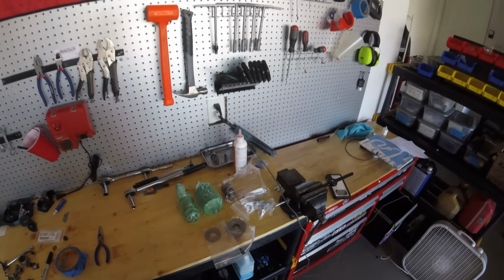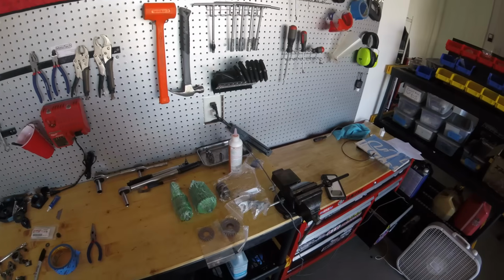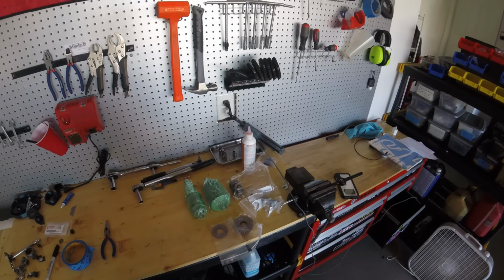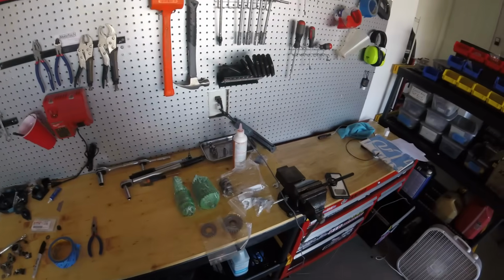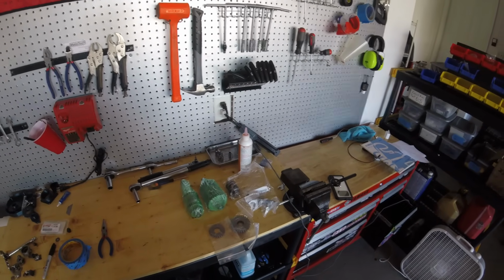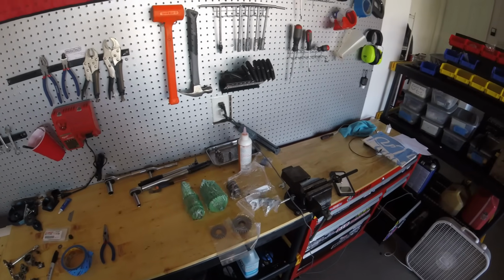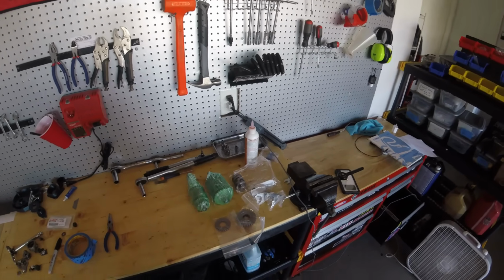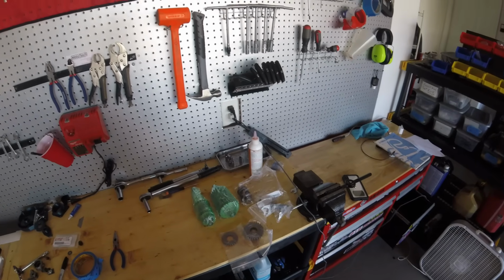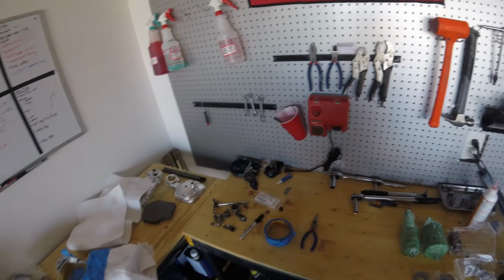I've had a couple people ask about cavitation. I'm not very worried about cavitation on this setup. The YZ impeller is a very efficient design, and there's nothing really wrong with it. And worst case scenario, I've talked with Boyesen. They agree with me. They design water pumps as well, and they have a super cooler that I could add later on if I deem it's necessary. But for now, this is what we're going to run with, and we're super happy.